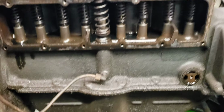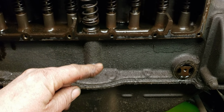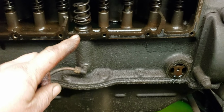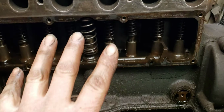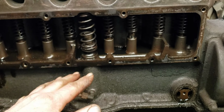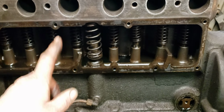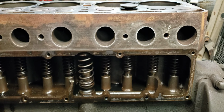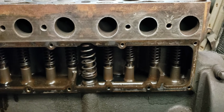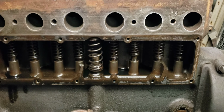And that is how it works. And then the rods, if anybody's taken old Briggs and Stratton apart, you've got the little dipper, and the dipper goes around, there's a tray in there, and it scoops the oil up. That's how the rods lubricate. So as the oil falls back into the engine, it goes in the dipper tray, and the dipper picks up and lubricates the rods, and obviously it flings the oil up and lubricates your cylinders and your skirts and your wrist pins, and that's why it's called a splash lubricating system.